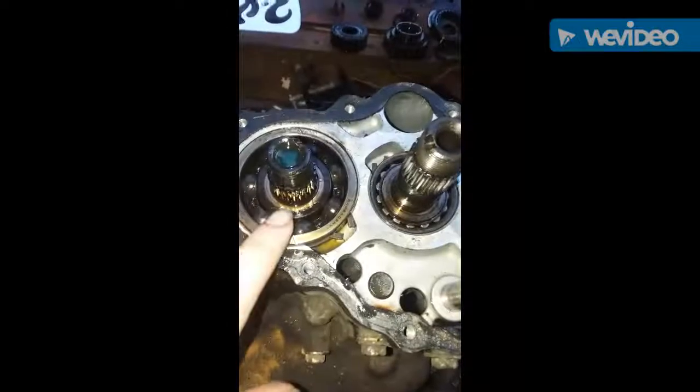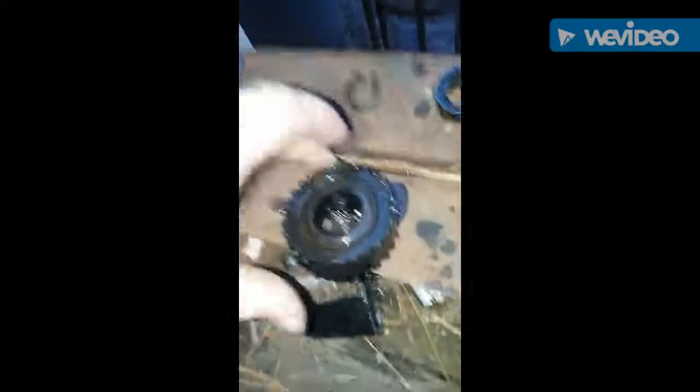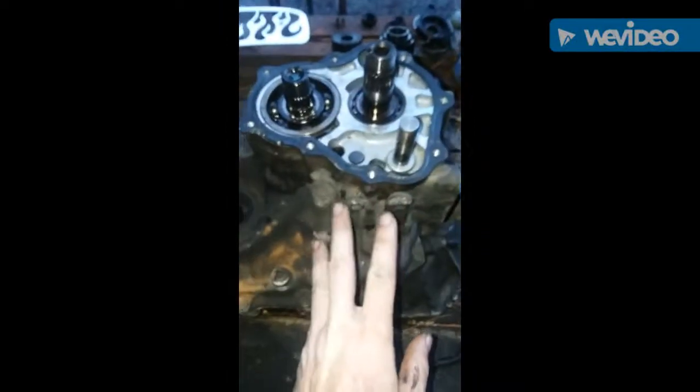I finally got both the fifth gear set removed. This one's pretty much stuck on there — it apparently got pretty hot and pretty wore out. Inside this part there's like a double knit needle bearing type deal. Next I'm gonna remove these three and catch the spring and ball, then undo all these around and lift this casing up and see what's up.